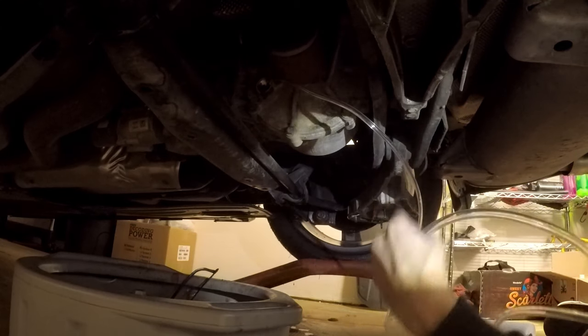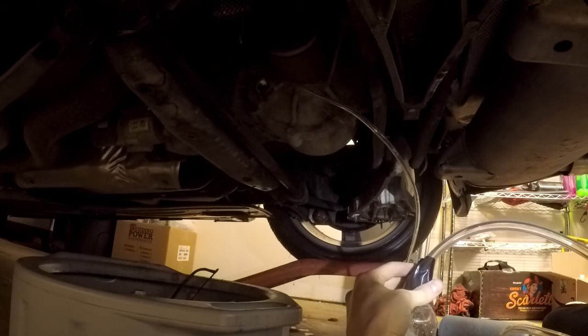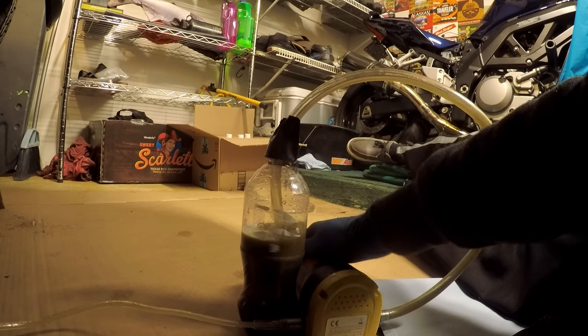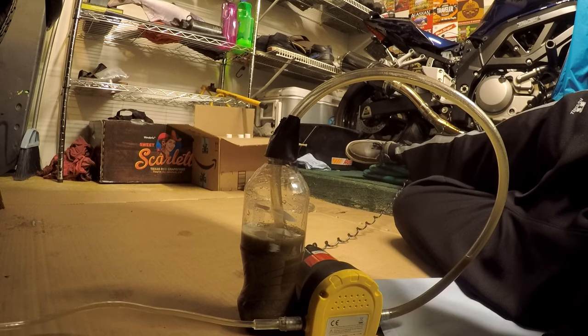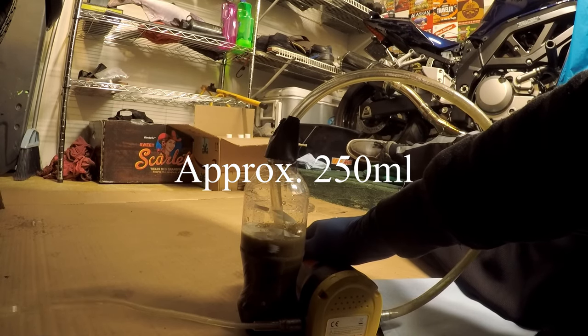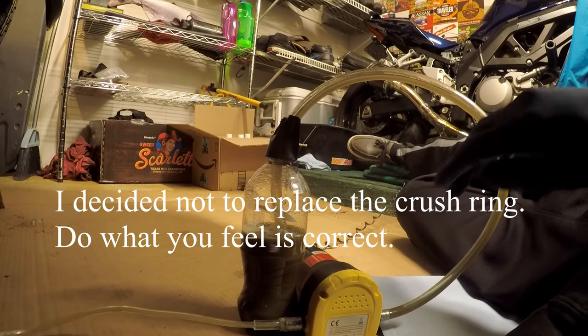Don't drop it in the oil as I did here. Now you can use the pump — put the tube as far down in the differential as possible and drain until empty. I was able to extract about this amount without getting the tube stuck in the differential.